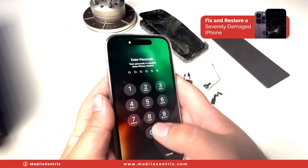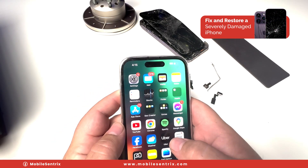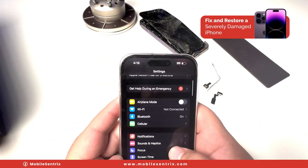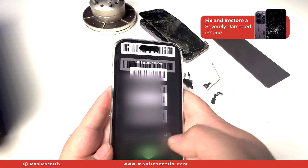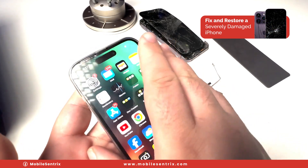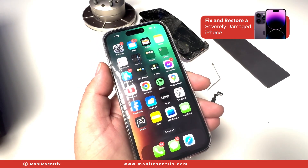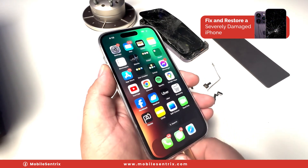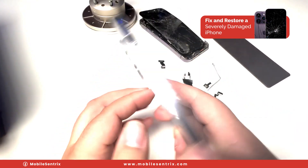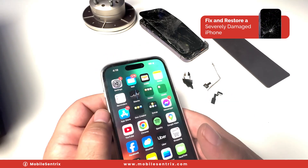Let's go ahead and see if we can get it to turn on. And there we got the Apple logo. Now if we have touch, that means the IC is on properly — and we have touch. We can test the flashlight. Everything looks good. Everything except the battery of course looks great. Got the passcode — we're gonna check a few things. The cameras are all working. The front-facing camera is working. All of the info is there when I go to settings and when I go to dial, so I know we don't have an issue with the sandwich board. The phone is running cool — no warmth coming out of it. Let's plug it in — it's charging at 1.6 amps, so we're good on charging. It recognizes Wi-Fi. I'm gonna run through a few more tests but everything is checking out so far, all the major components I was concerned about. We are good to go.